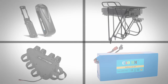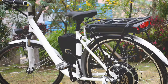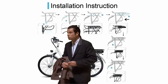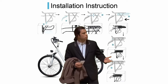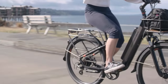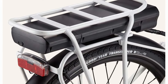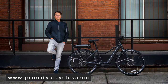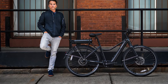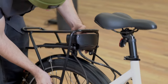The second most common e-bike battery add-on is the rear rack style — though it is actually probably the least common of the four. It is essentially a battery mounted via a rear rack attached to the bike. Adding these can be a bit troublesome since the racks are designed as a one-size-fits-all attachment, so they may not work easily with every bike. Many e-bikes now come with a rear rack already included, so you may have to do some modifications or replace the stock rack entirely. Rear rack batteries can look relatively seamless when done well, and if you don't have a viable place to add your second battery, this option could supply everything you need to get it mounted.